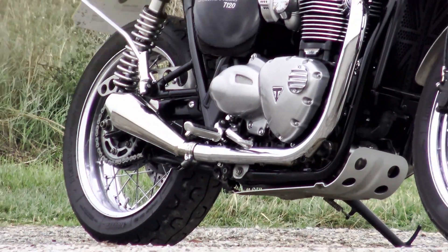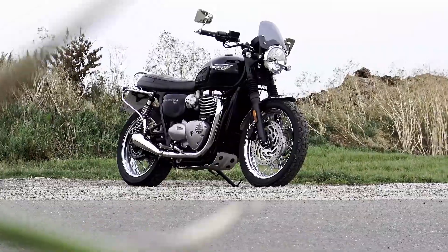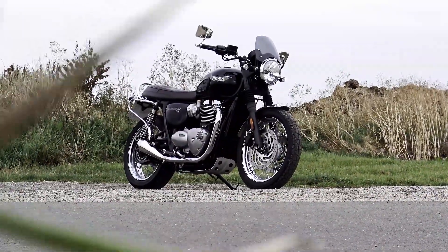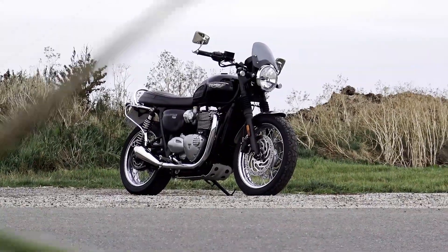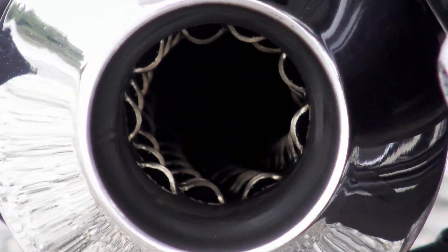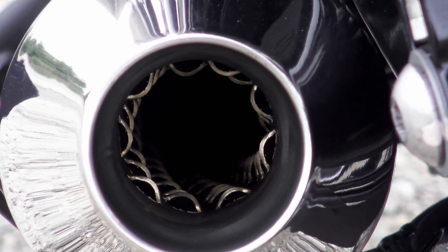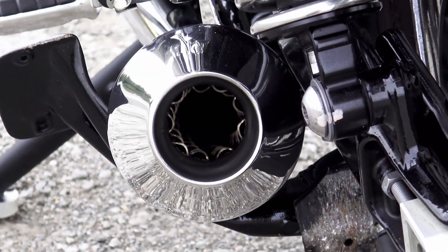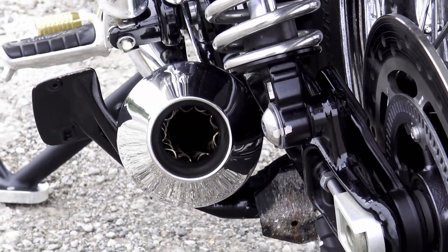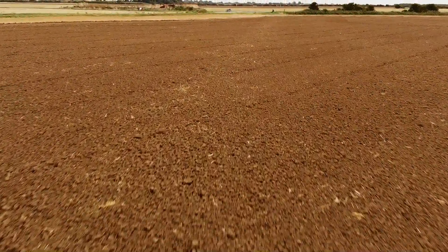In its stock configuration the Bonneville will only pull 30 miles an hour in maximum third gear — anything above that and it simply doesn't want to know. As I reported with the Sleeper Pros and the cross pipe configuration, more torque was available, lowering the rev range, and it was possible not only to maintain 30 miles an hour in fourth gear but if you were gentle you could even accelerate away from that point. The Predator Pro Shorty has raised that bar yet again — in fourth gear at 30 miles an hour the bike will accelerate without complaint, and it will now quite happily hold 30 miles an hour in fifth gear, something this bike simply refused to do in the past.